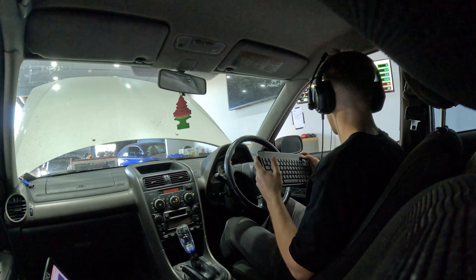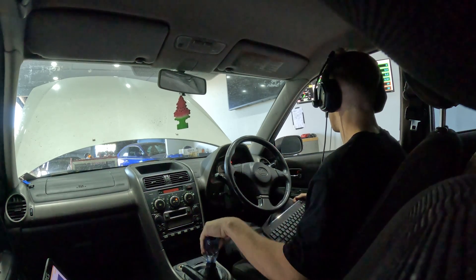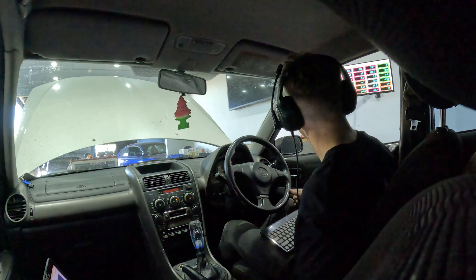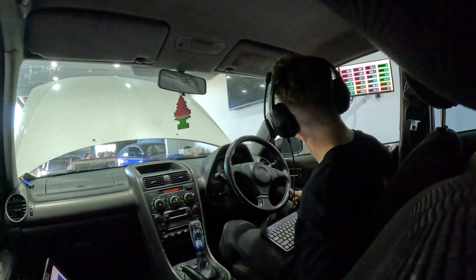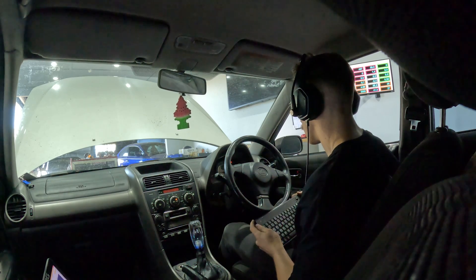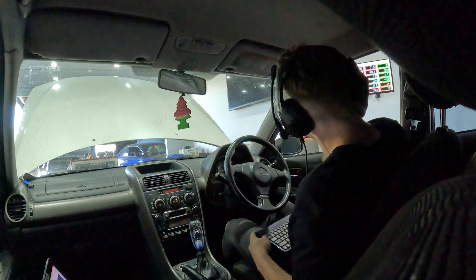Welcome to the voiceover. I got a lot of positive feedback when I was more technical in my engine building video, so I thought I would do the same here. The first thing you see me do is run the car through a couple of gears and load the engine up at a set RPM. The dyno puts load on the rear wheels, holding the engine at a steady RPM regardless of throttle input — this is called steady state tuning. This allows me to sweep through the load axis from vacuum to boost at each RPM cell in the fuel map and accurately tune the air fuel ratio before moving on to ramp runs. It's important to note I set the timing map to very safe values while doing this — you'll see in the coming clips just how big a difference a few degrees makes to total power output. The headphones I'm wearing are called knock ears, allowing me to listen to the engine and monitor for any knock events when tuning.